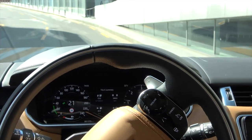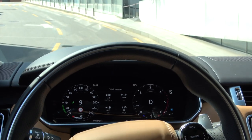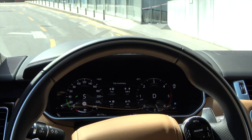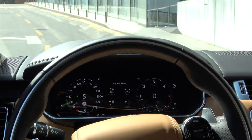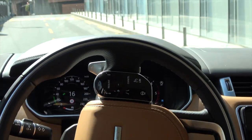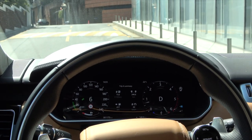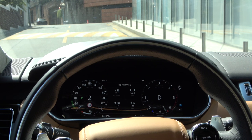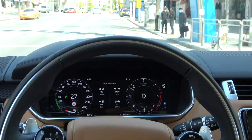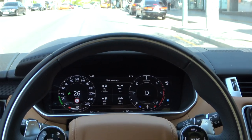Let's look at the situation on an uphill road. If you take your foot off the accelerator pedal while climbing, the vehicle will stop gradually due to gravity — not at the speed set by HDC. Similarly, on flat ground the vehicle will stop gradually due to frictional forces. HDC only works downhill, detected by the vehicle's gyro sensor. Therefore, the downhill control function does not work even when HDC is activated on an uphill or flat road.